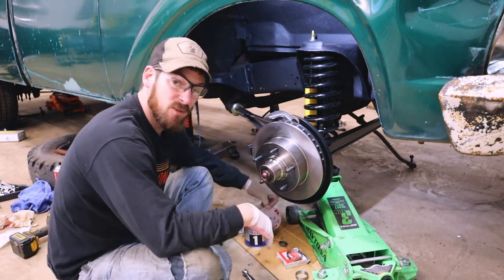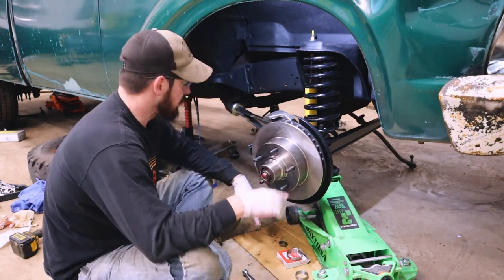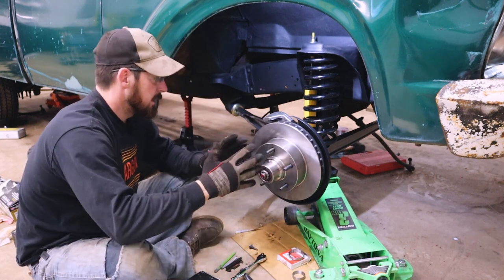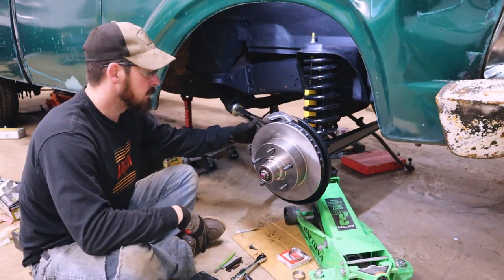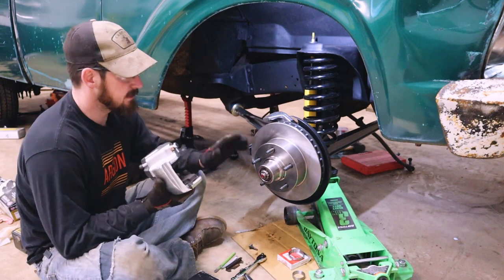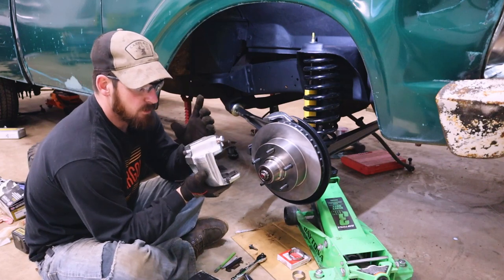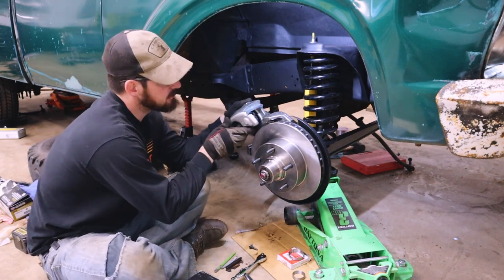I need to get some cotter pins — fresh out. I'll pick up a variety pack of cotter pins and put new cotter pins in all the joints. Now that we have the wheel bearings and rotor installed, I'm moving on to the caliper. I already have the brake pad set on the back. There's an anti-rattle clip that goes on the bottom of that pad — stick that in, drop your front brake pad into the caliper, then set the caliper on. Luckily it has an 'R' marking to tell you which side it is; if not, you can always put the bleeder valve pointing up.